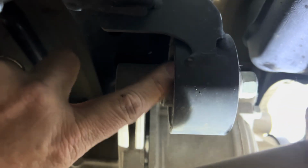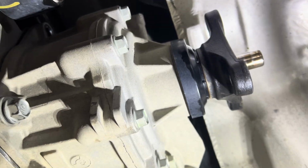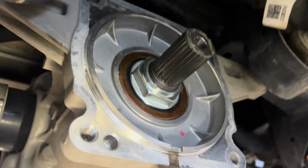I loosened this bolt and the one on the other side, and up in here, there is one and one on the other side. So I took the top 2 out. This thing's loose, no liquids coming out. I disconnected the 2 plugs, and now I'm just going to loosen these 2 bolts and lift this off. All right, so that lifted right off. Took the 2 bolts out, no leaks, slides right off that keyed shaft.